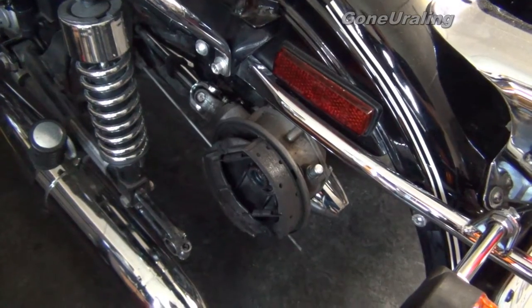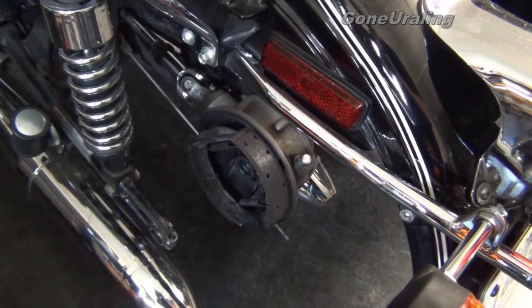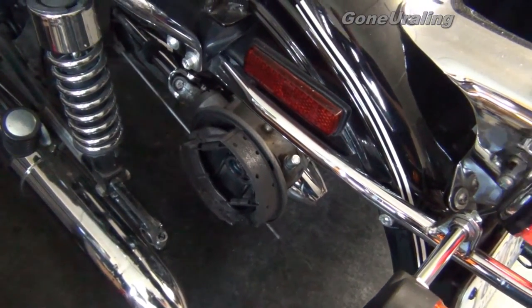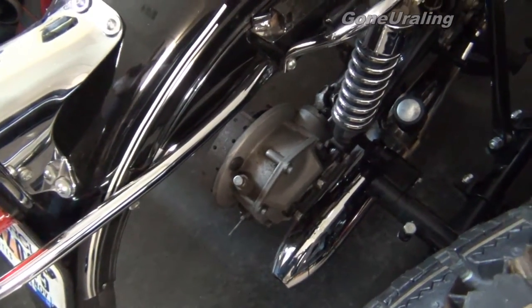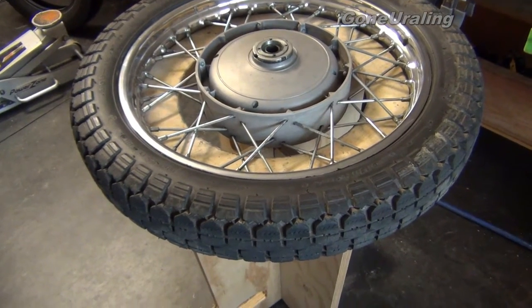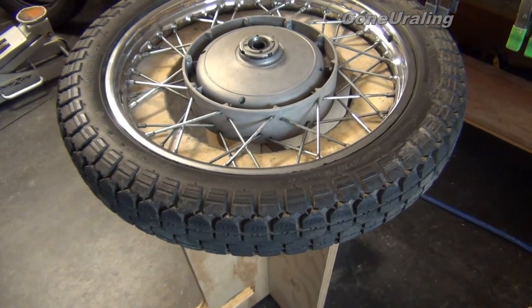Like with these Russian bikes, everything's a little odd and awkward — I really don't believe any two are identical. I had a little bit of trouble getting the axle out, had to get some leverage on it, but once it broke free it came right off. We've got the pusher tire off, I've already pulled the valve stem, deflated the tube, and that's where I'm at.